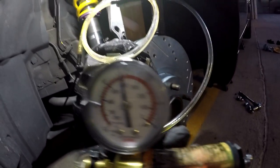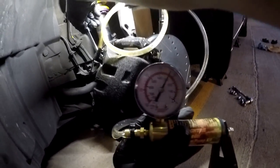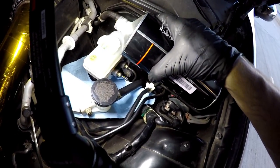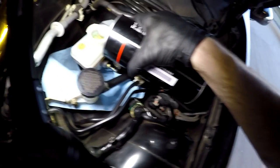Now we're starting to get full on the little tank — see how dirty it is? Since we're starting to get full, we're going to have to crank this down and go up there and fill up the brake reservoir with more fluid. Go ahead and top it off.